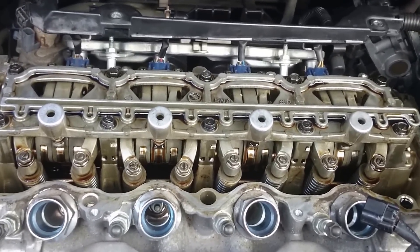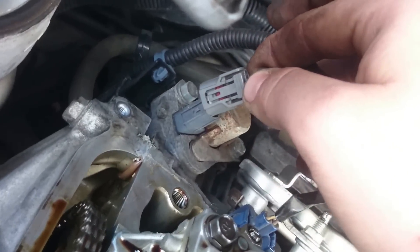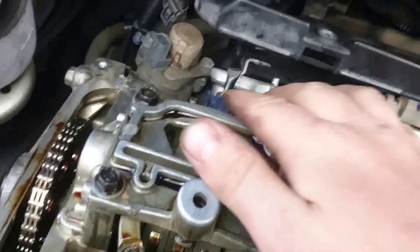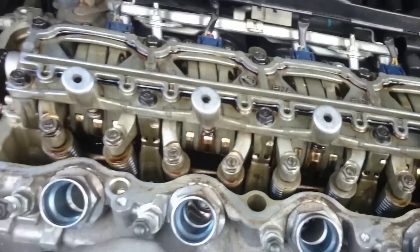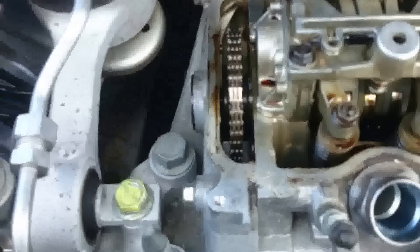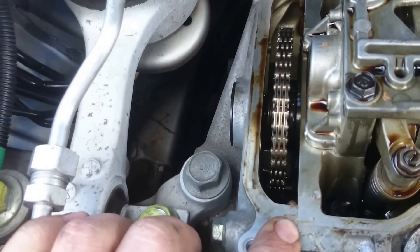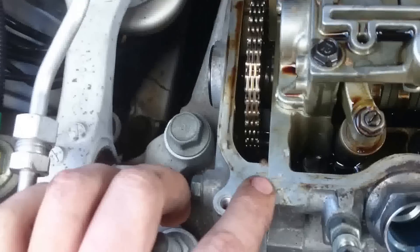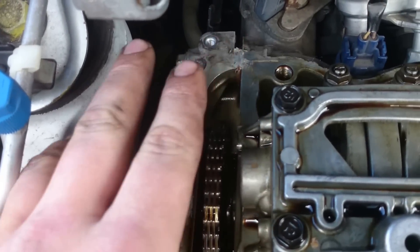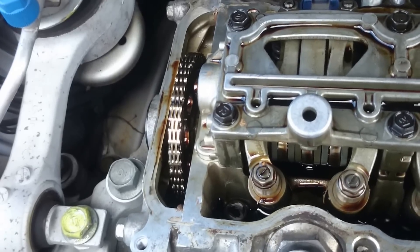When reinstalling the gasket, make sure everything goes back together as it should — make sure everything you take off gets plugged back in. The gasket sealmaker I mentioned earlier: one dab needs to go here where the timing chain end joins, because if you don't seal there the gasket will leak oil. Then another dab here just where it joins on the other side. That's all you need to do gasket-wise — it is literally a tiny amount.